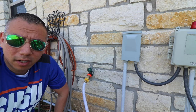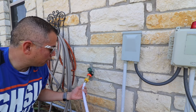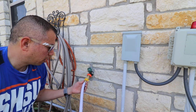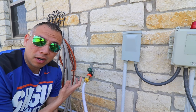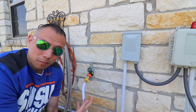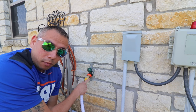Let's go outside and I'll show you how we have our water set up coming into the RV. Our water pressure regulator is nothing fancy — it's just set up right here at the spigot. Just hook it up, and then from there we have our water hose. This is our drinking water hose and nothing else — it isn't used for anything else. We just hook it up and run it out to the RV. I always wondered whether the regulator had to go at the RV or here at the water spigot, and I found it goes here at the spigot where the pressure is first coming out. So if you're wondering that as well, this is where you should plug in your water pressure regulator.